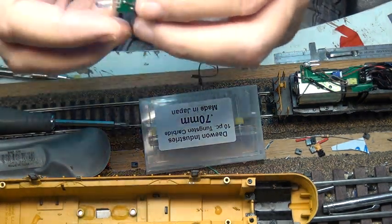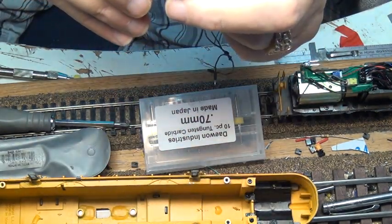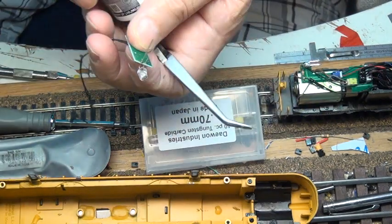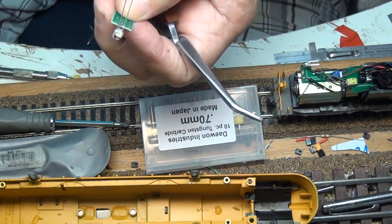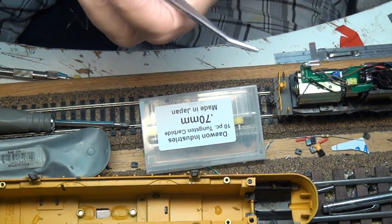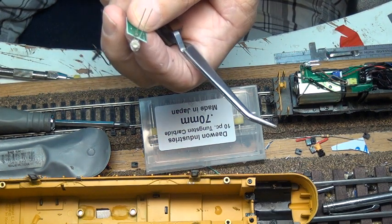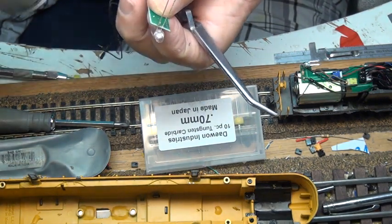And again, it was up like a tenth of an inch, but since this bulb is so much bigger, you're going to lower it just a little bit from where that was. So I'm bringing that down just a little bit more. Now, to secure the bulb, make sure the bulb is as square as you can get it. And then work from the bottom, because you really can't protect it, and put a little bit of solder paste on it. Not solder paste, but some flux.